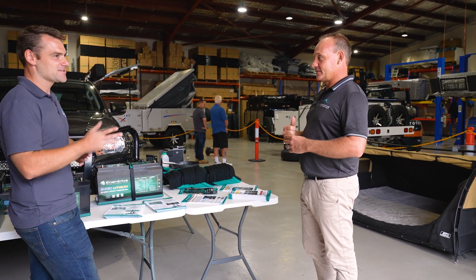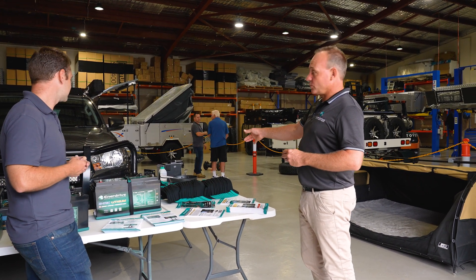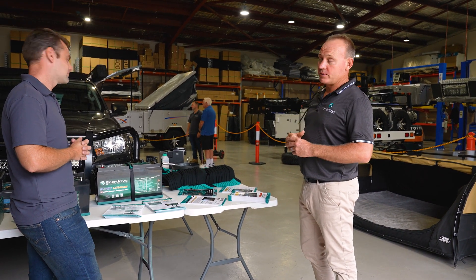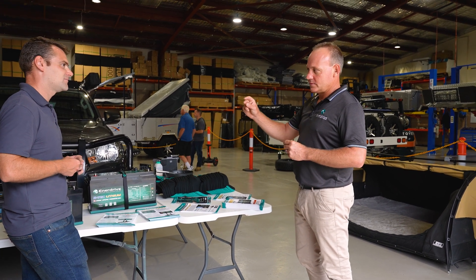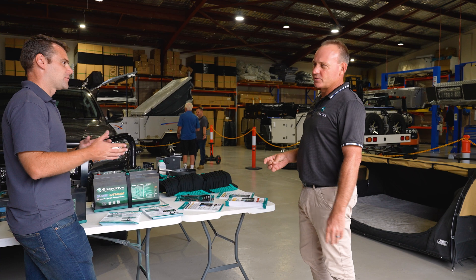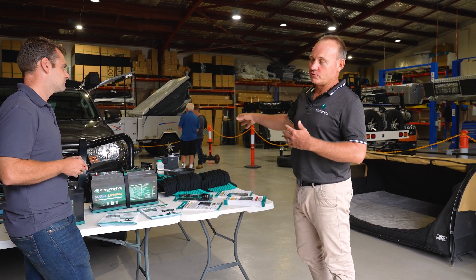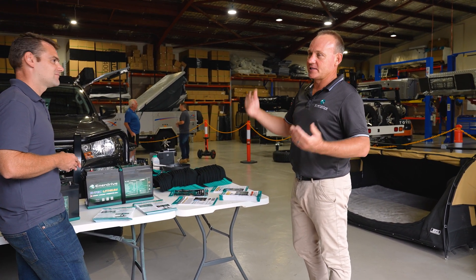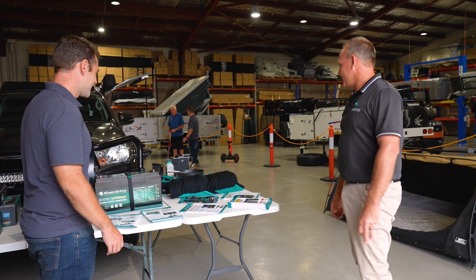A big one is coffee machines - we've set up a pod coffee machine. What sort of power does it take to run? That one there is around 1200 watts. We'll show you the actual draw on the E-Pro Plus battery monitor later. It draws around 120 to 122 amps for about five seconds, just to heat everything up and push the coffee pod through, then it just drops. On average, to make two coffees and cook baked eggs or pancakes, I use around 12% of a 200 amp battery. With solar, that's charged up within at least an hour - back up and in action by lunchtime.